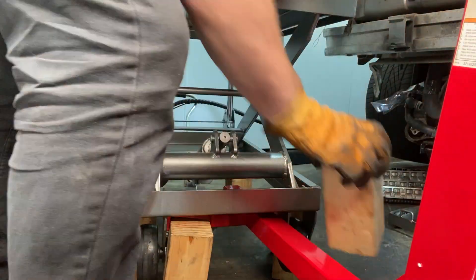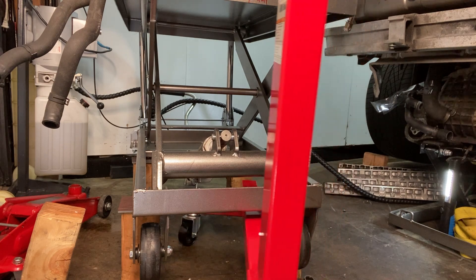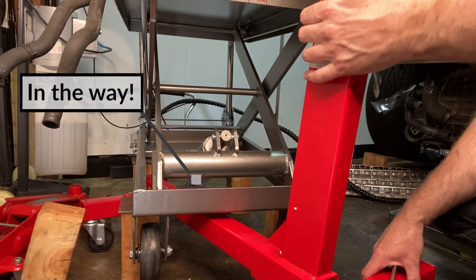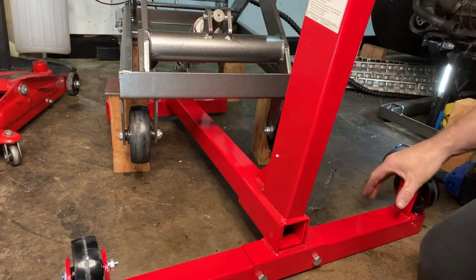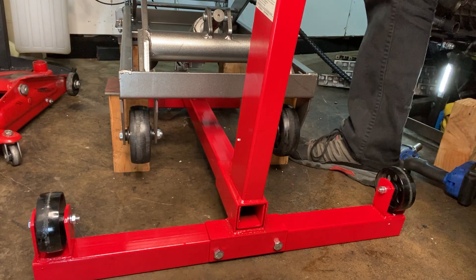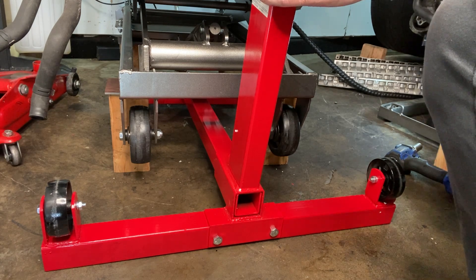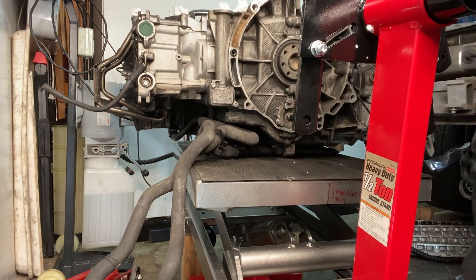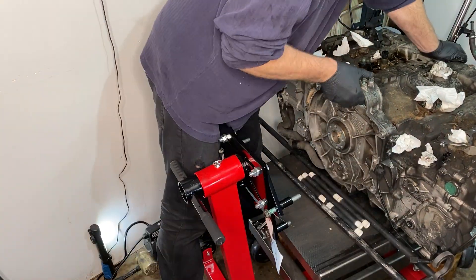It was just touching so I put some floor samples on top of the pieces of wood. While that did make it possible to get the engine stand underneath the hydraulic table and move it around, it wasn't high enough to get the engine stand to go all the way through to the other side — the hydraulic ram part was in the way. I didn't feel comfortable moving the hydraulic table any further up, so I decided to flip the wheels on the engine stand to make it that much lower. That did seem to work. I was able to get the head plate and the mounting arms close enough to the edge of the hydraulic table to hopefully move the engine towards them. The engine is too heavy to simply lift or drag it to the end of the table to meet the mounting arms, but it was possible to kind of lift the end of it. That got me thinking I could channel the Egyptians and use rollers, so I had my daughter help me — I lifted the engine and she pushed the rollers underneath.